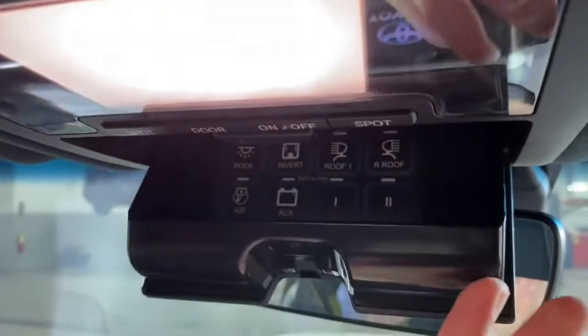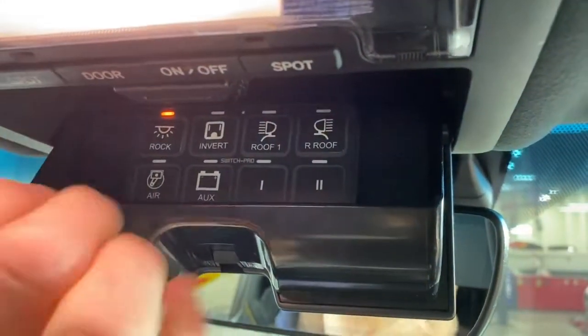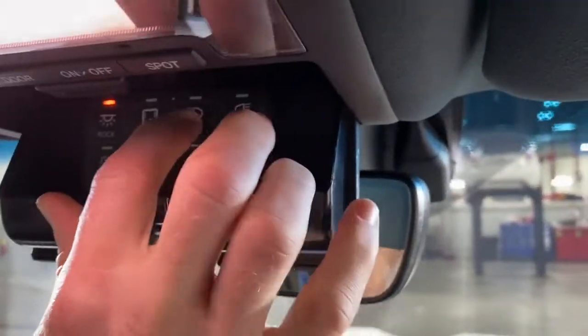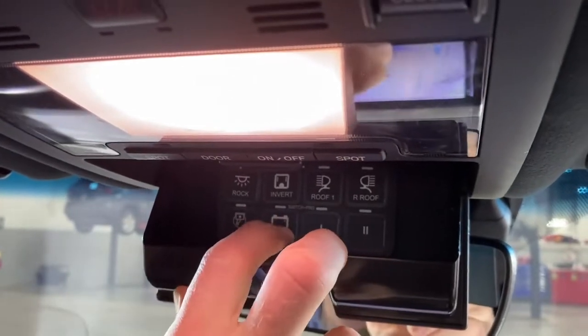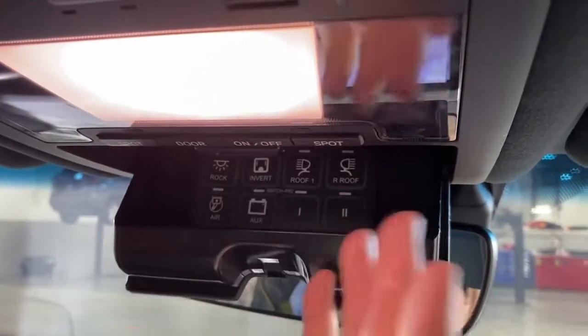On the inside, we have the Switch Pro 9100 up here — rock light override for the doors, wired into the dome light circuit, and the power inverter. Right behind the center console, we added a couple of 4-amp USBs, a couple of household power outlets, and a couple of 12-volt outlets. Roof rack front and rear, air compressor, and then we have the batteries with a smart isolator so we can connect the batteries if the crank battery is ever dead — right through the Switch Pro. We also have one and two auxiliaries we can use in the future.